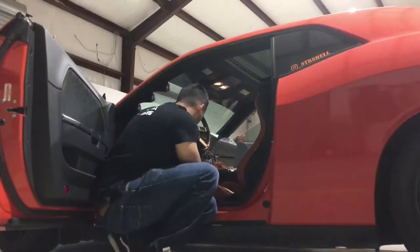All right, so before I actually start marking up the harnesses and the lengths that I want, I'm gonna go ahead and take my seat out right here and put the side belts on, because that's a little easier. I use the eye bolt and install it to the bracket on the Planted Seat Technologies bracket on here. And that's where I put the eye bolt for, in this case, the strap on your right side. So I'm gonna go ahead and take the seat out and we'll put that eye bolt in and we'll strap up that harness, and then we'll go ahead and start strapping up the harness bar.